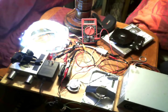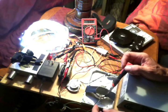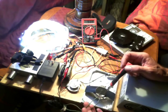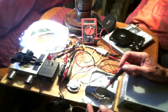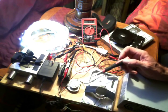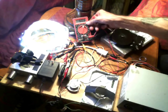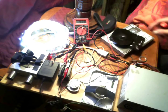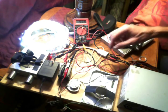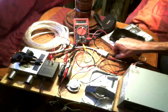I thought that would be a neat little update — running one of these hard drive motors as a generator. There are only two of the wires off that hard drive that I'm using; you could use the other two for a totally separate circuit. It's showing 90.8 volts AC under load, and when I take the load off it jumps up to about 102–103 volts.